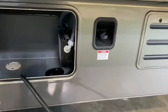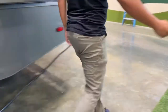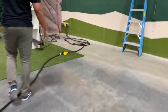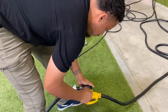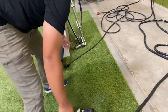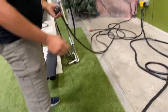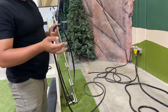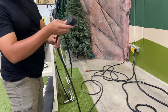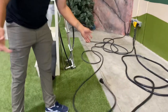This is your 50-amp cord — you can see it has four prongs and connects over here. This is a 30-amp cord, which is thinner. Most RV hookups carry 30 amps, so it'd be smart to buy an adapter so you can plug into 50 or 30-amp service at different campgrounds.